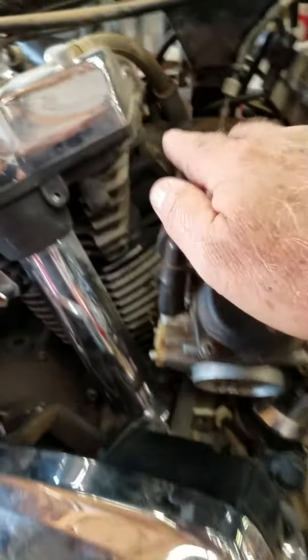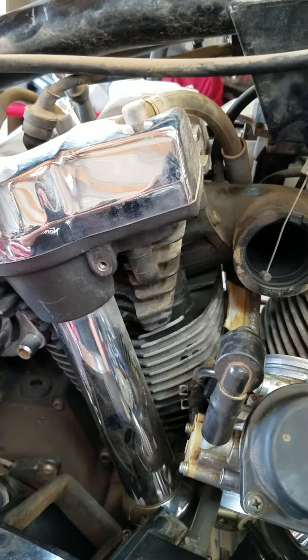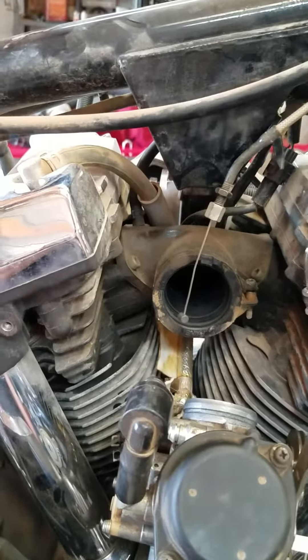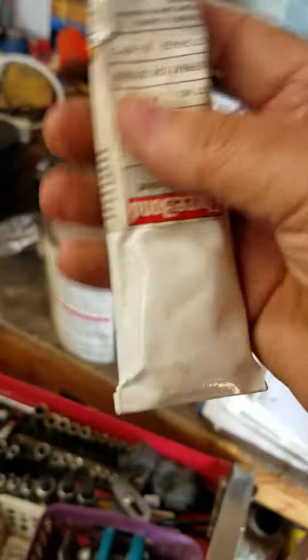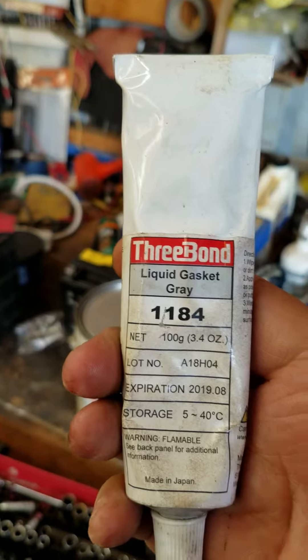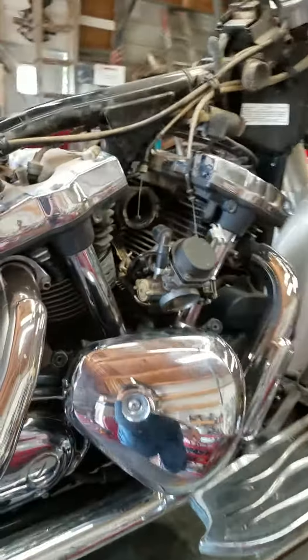And the little O-ring that goes between here and the head — it don't really do much, I'm telling you. I put them on three times, brand new, everything new, and they leak. So what I do — an insider tip from a pro that I swear by — is 3-bond 1184. You put a good liberal dose of that on them, it's not gonna leak.